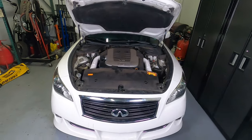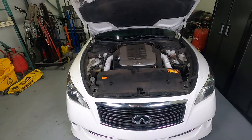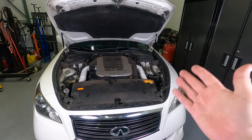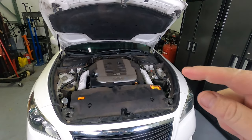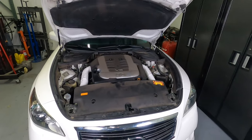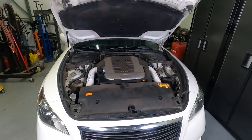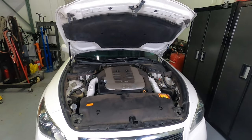After looking again I do see some little carbon stuff I can chunk off — I have some tools I can reach down in there and get some of the big stuff off. For the most part there's really not much going on. The walls and cylinder heads look cleaner, but the actual valves — maybe slightly cleaner. For $26, taking a vacuum line off and sucking it in, blowing smoke out your exhaust for 25 minutes — maybe I didn't do it right. Comment below and let me know if I did it right or wrong. It is all buttoned up — clear the codes, probably just a misfire code. Overall I would say don't waste your money on seafoam.